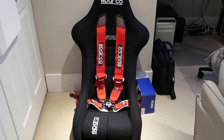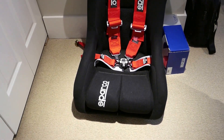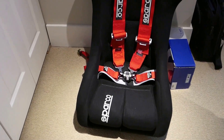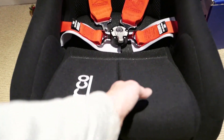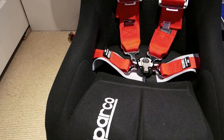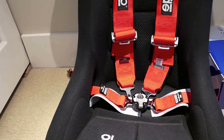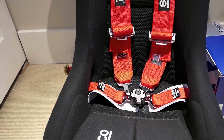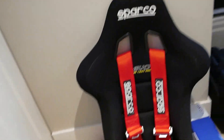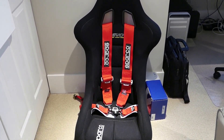These are the Sparco harnesses I'm going to use with the cam lock. Sparco only has a dual anti-submarine crotch strap, and the way this particular seat works it wouldn't make a difference whether it's one or two, because it's got a single slot and single hole in the bottom. I'm pretty sure this cam mechanism is compatible with the Simpson cam lock, so I ordered a Simpson single anti-submarine belt and we'll see if it works. I'm sure I can jury-rig it. I'll get the bars for the car set up so the seat belts are at the right angle.